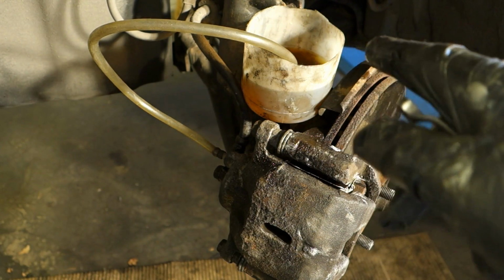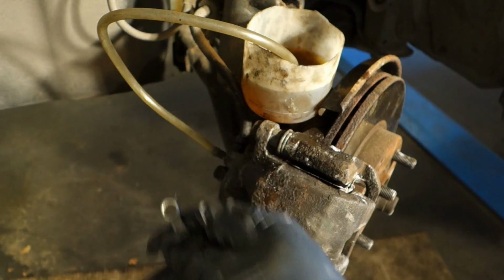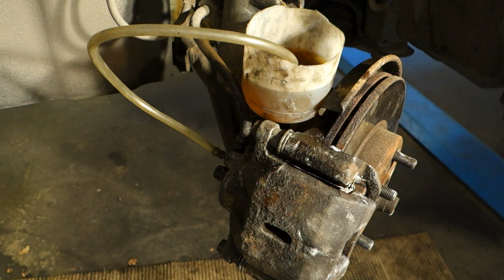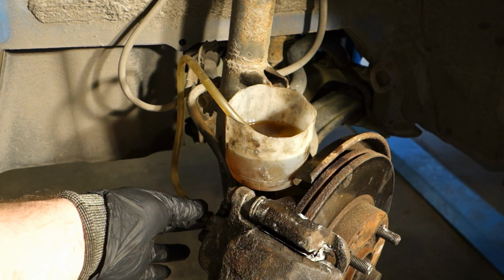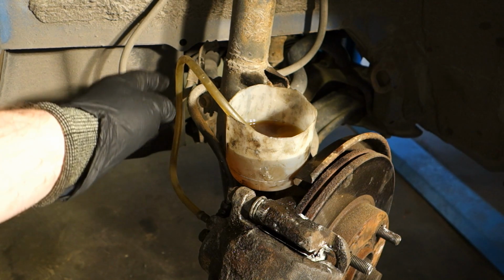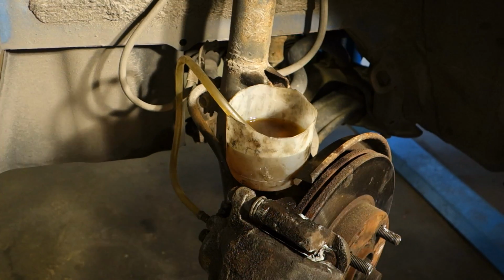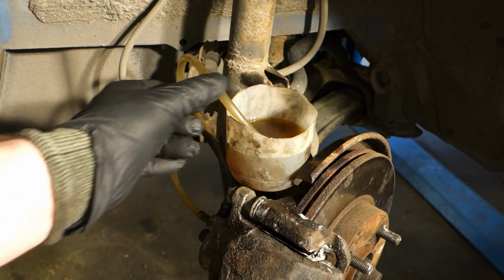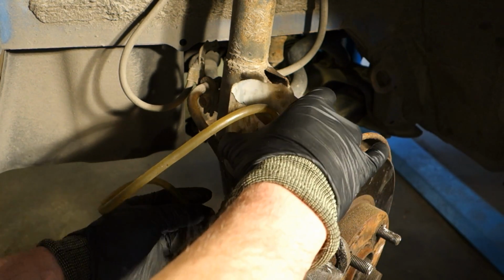And next I go to brake. My assistant presses the brake pedal, and then I wait until the air bubbles end in here, then I fasten and close that nut. But let's do that next. Okay, now we are bleeding, and this nut is a little bit open, so much that the fluid can go in here, and we wait until the air bubbles end, and then we press the car's brake pedal. We can see that now there is movement, and now I think that this line is full of brake fluid, and then I can close this nut.